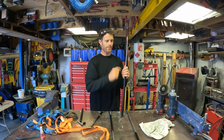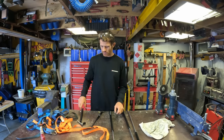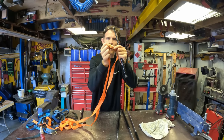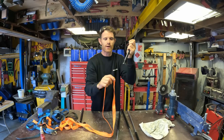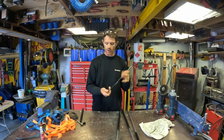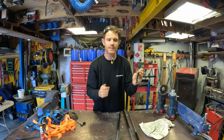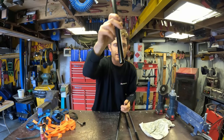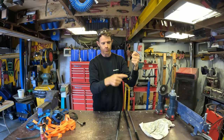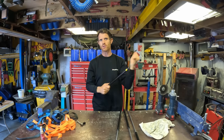I've come up with a brilliant idea for getting them on. What you've got to do is wrap a ratchet strap around the strut and compress it to pull the strut down because the struts are too long. The problem is it pierces a hole in the strap, and a thicker strap covers the ball on the end. What I've come up with is using the jack handle from your jack — all I've done is cut a little slot in the end of it. That slots into the ball, so when you're strapping it, it goes round the circumference of the bar rather than digging in — it just spins round it.